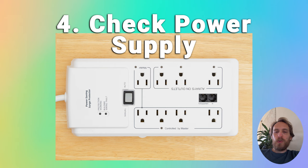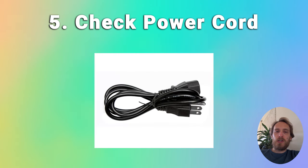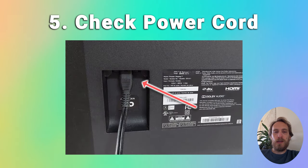You can also try using a wall socket on the other side of the room. Make sure to look for damage to the power cord, in particular looking for kinks and knots, and if you have a replacement available try that. Also have a look at the power connector on your TV and confirm that the port is free from corrosion, dirt and dust.